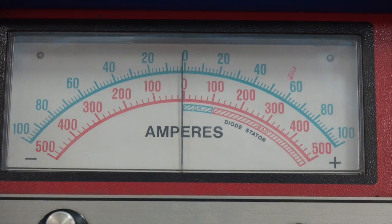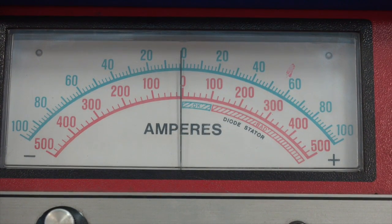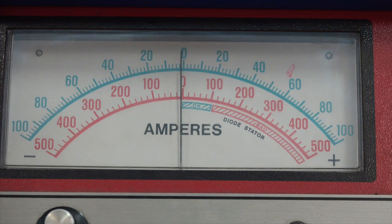What the red and blue refer to is the amperage. On the amperage scale, we've got one in red and one in blue. For those of you that are colorblind, the top is blue, the bottom is red. The top blue scale goes from 0 to 100 amps, and the bottom red goes from 0 to 500 amps. When we're dealing with starters, that's why we're in the red — the 0 to 500. This machine has been around for probably 30-plus years. Back then, alternators over 100 amps weren't common, but today I actually go to the starting scale when testing alternators to get over 100.